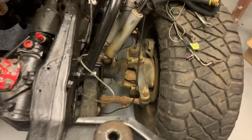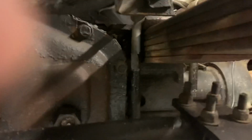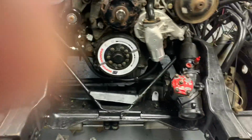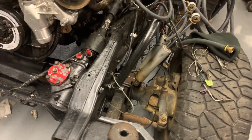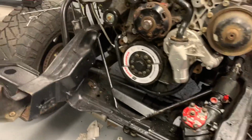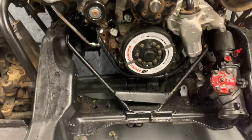The axle is an 86 Ford. So 86 means it's still kingpin, it's still high pinion, but it's the wider spring pad. So you can see that the spring perch is like integrated into the meatball. And what's kind of silly is everyone always talks about the 78, 79 axle as being the most desirable because it's kingpin and high pinion, which this axle also is, but it doesn't cost you an arm and a leg to get this, because you can get these in like F350 brick nose and bull nose trucks.